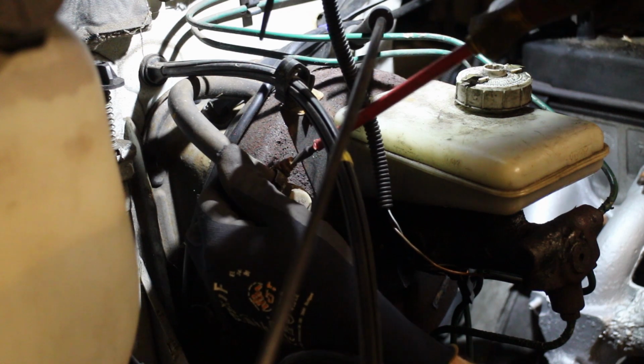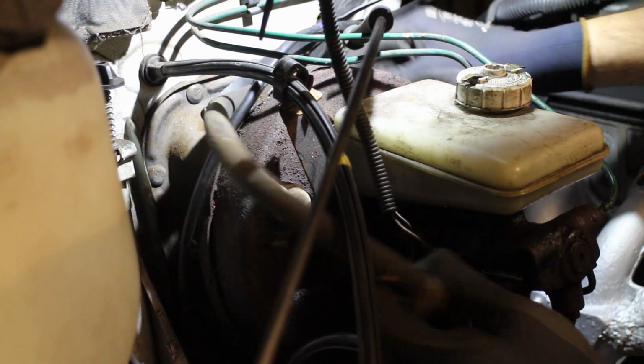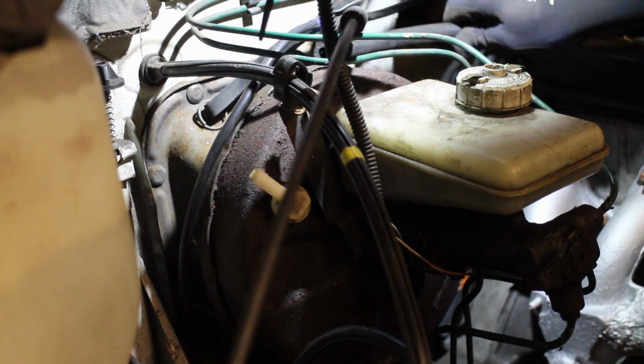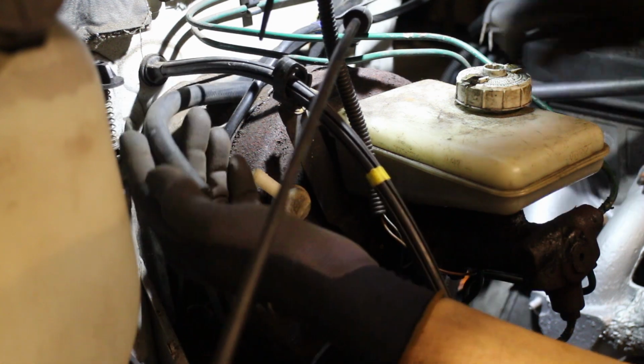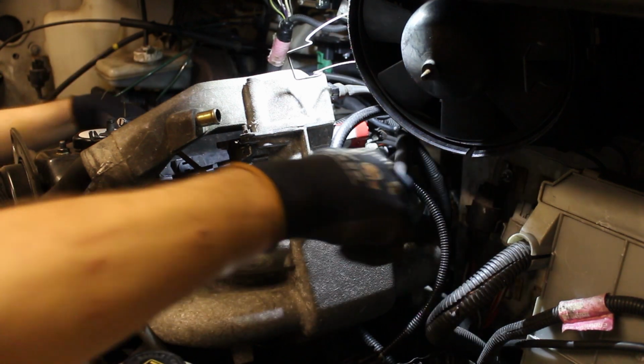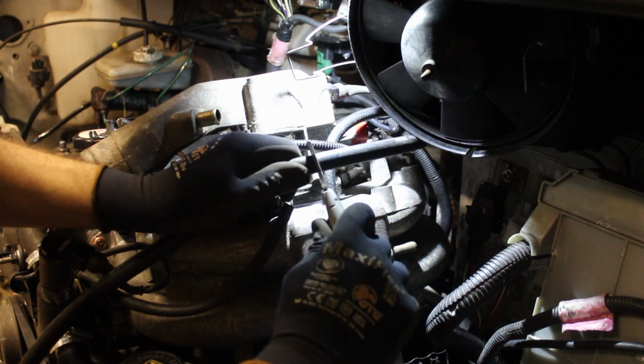Now, if you haven't worked out already, my goal at this stage is to get the engine to fire up, so my main focus is on anything which might stop it running. One of those things is the vacuum hose for the brake servo, as without it the inlet manifold would suck air in and would likely mess the mixture up. The original hose is now too short as the inlet manifold has swapped sides, so a longer one is needed. This is just a standard 12mm rubber air hose. With it in position, I can cut it to length and fix it on the manifold.